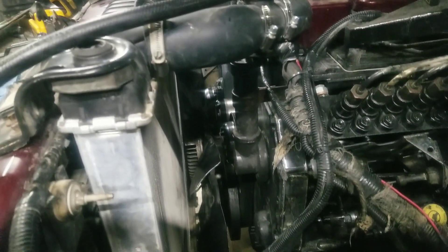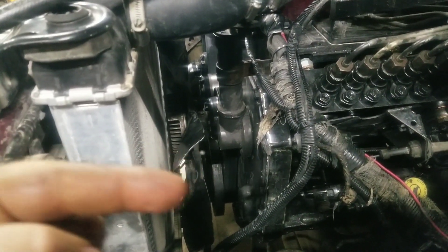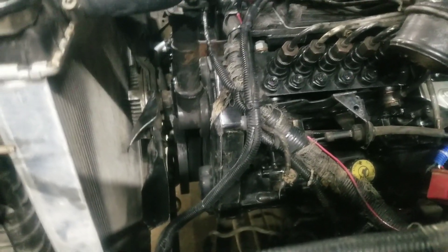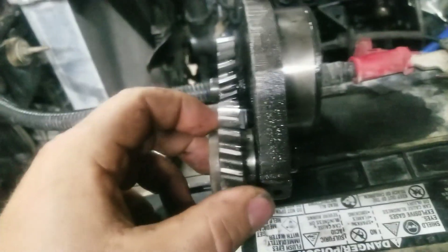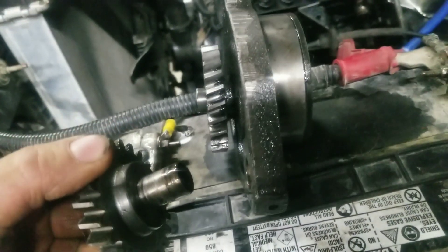Then we're cleaning up the front, cleaning all the gunk and gaskets off and wiping the gears off. We noticed the oil pump down there - the idler gear, the one that's driven off the crank. It's got two gears: one driven off the crank and the other is the actual oil pump gear. We noticed one of those is kind of a little bit loose. They're sitting in here at the very bottom of the engine and we're wiping up these gears - no problem this way, but this way... holy shit, that thing came all the way out.